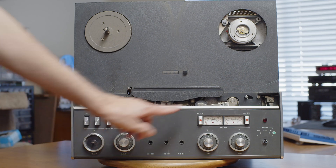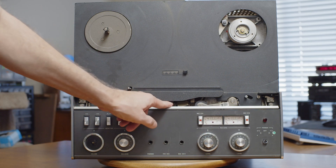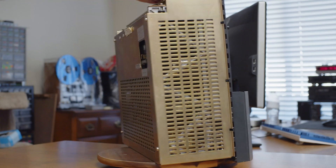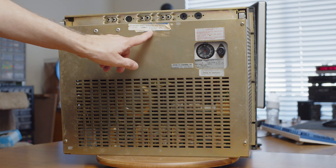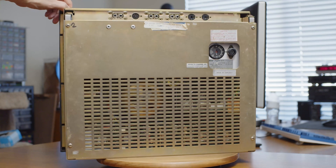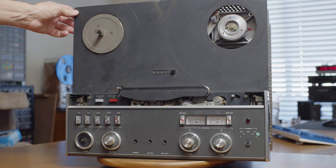This is a two-track machine. The heads, which are under here, — the playhead is the most worn one. It's twice as worn as the record head, which makes sense because here it says the new record head was fitted in 1992 but the playhead was never changed. So it's kind of flat but it's not worn out. The heads are still serviceable and I should be able to get this working with the heads in the condition they're in.